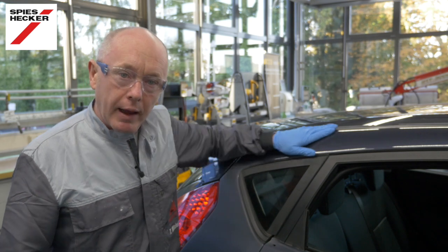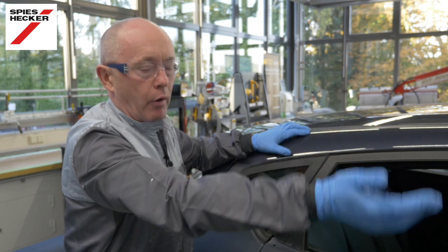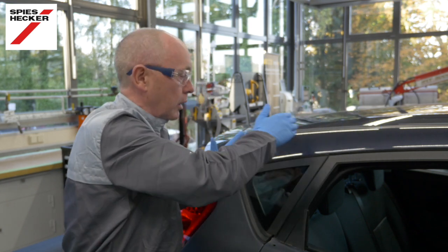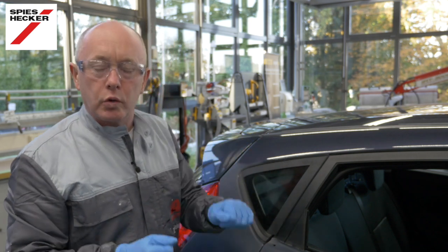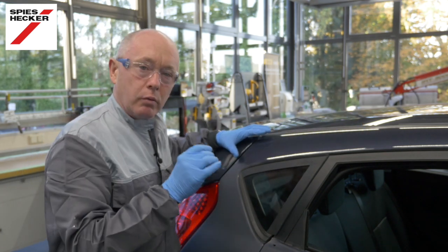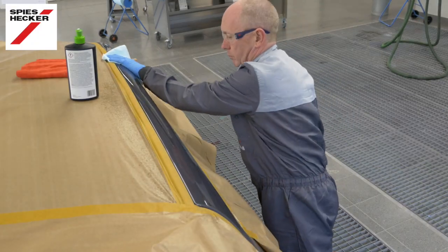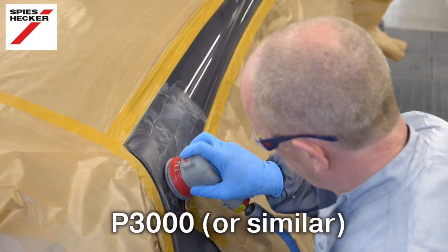With regards to the rail itself I now have a couple of options. I can completely sand it and put clear over the whole thing, but of course that doesn't really show you much. Traditionally what I would have done is lightly sand this area and make my fade out into the sanded surface, just to give me a little bit more security when polishing the blend at the end of the repair. The process related to this clear is slightly different — I want to clean it, polish it, clean it again to remove the residue, lightly sand it, before a final clean and placing the car in the spray booth.